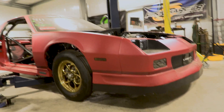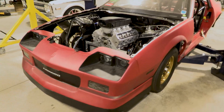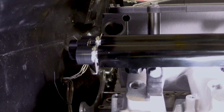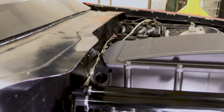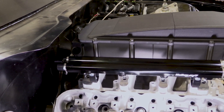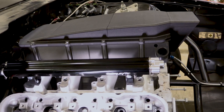This is your third gen with the LS in it. This is pretty much where the factory motor mounts would have been for an LS swap — pretty much exactly where an LS swap would land in a third gen. In this application, there are tons of room. I don't have a wiper motor in mine, but I don't foresee that being a clearance problem anyway, because it's really high on the firewall versus where that fuel rail would land, even with tall injectors.